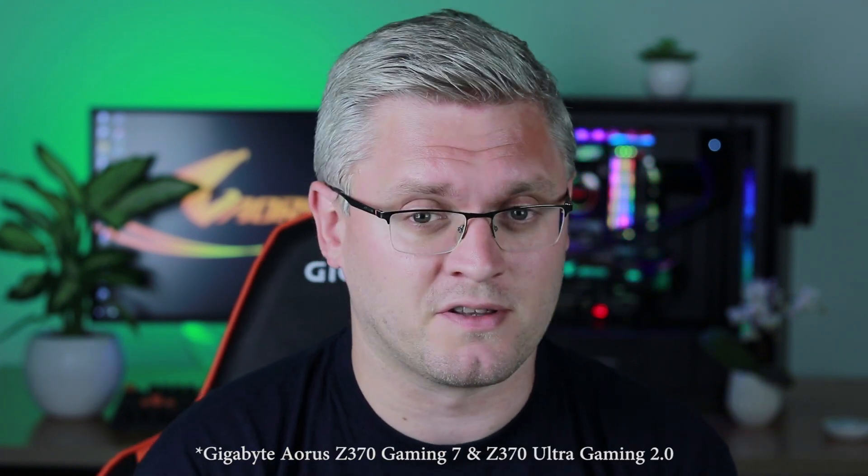Aside from the software, what else did we run into? Everything was working fine with our Gigabyte board, but as soon as we grabbed an Asus board we couldn't get the system to post at all. We removed the dummy modules and the system posted fine; add them back and the system simply does not start up. We grabbed another Asus board, the Z370F Gaming, and ran into the same issue. This is definitely not something Gigabyte intends, since they even made a software package specifically for other manufacturers. However, it's very early in the retail process, so compatibility with other motherboards is something to keep in mind. For now, if you're considering it, we'd recommend sticking with Gigabyte boards — we tested two of those and both worked fine.